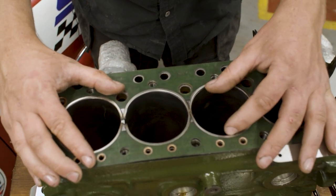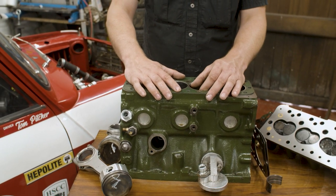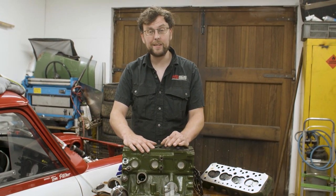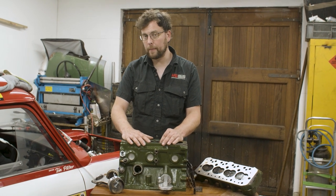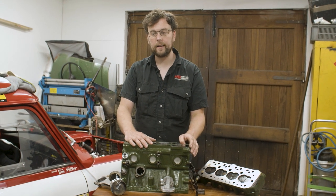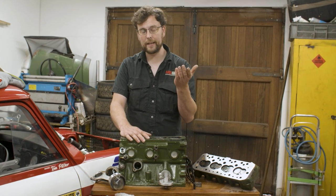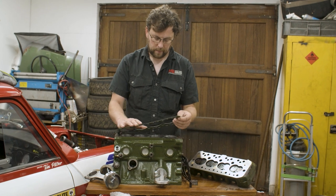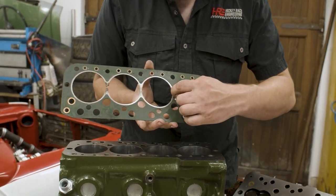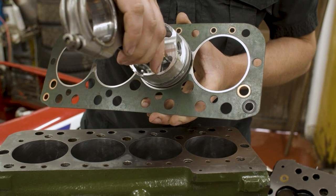On measuring this gasket we found that after it's squashed it's less than 73.5 millimeters — in fact it's 72.9. The pistons in this engine are 73.5 millimeters. If you remember back, I said the pistons were coming slightly up out of the bore and I was thinking maybe they were hitting the cylinder head — that's why the gasket was failing. But actually, looking at the gasket, we can see witness marks where the piston clearly hit it.